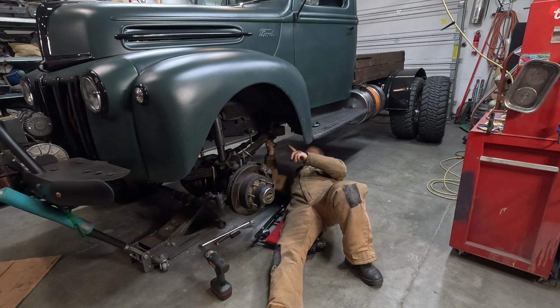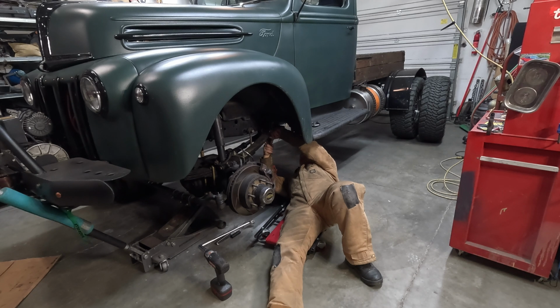Now, I'll show you these when they come out, but they're kind of a neat design, which is why I used them. They're greasable, and the pins that go this way are already mounted in this front or outside shackle. So it makes it a fairly strong unit and easily greasable with the greaser sticking right out. But it's got to slide in from this side.